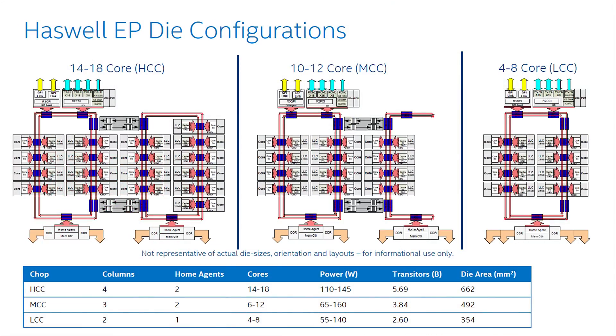The reason AMD has gone with this modular design is simply that it is modular. The design has allowed AMD's new Zen-based Naples server chips to pack up to 32 physical cores per chip using multiple CCX modules. So essentially, Ryzen is a server chip that's been scaled down for desktop computing. As Intel scales up cores in their Xeon CPUs they also use a modular design called cluster-on-die, or COD, which splits the CPU into two — ideal for highly NUMA-optimized workloads. But we won't go into detail about that here.